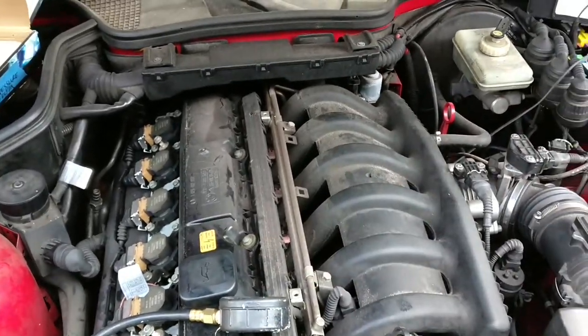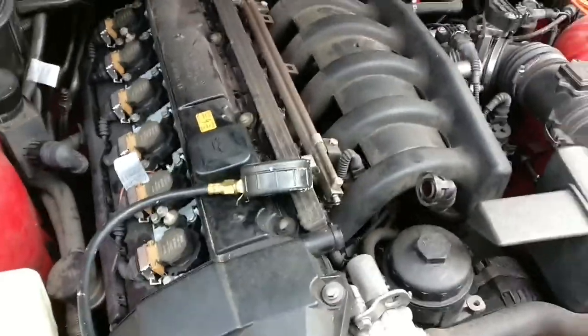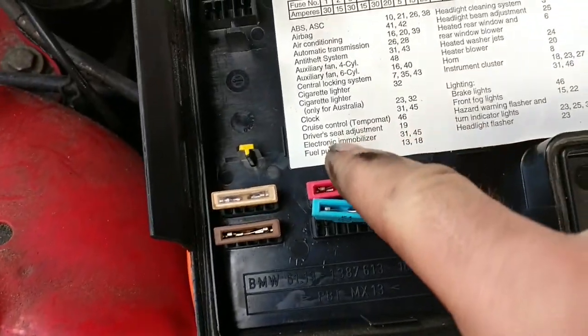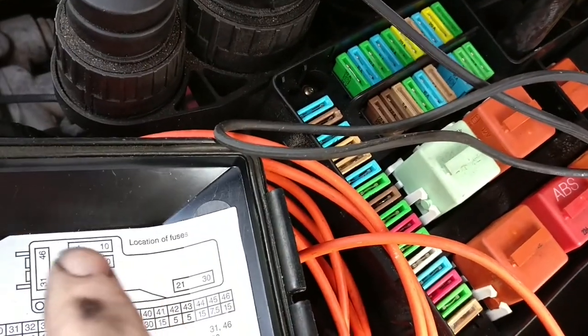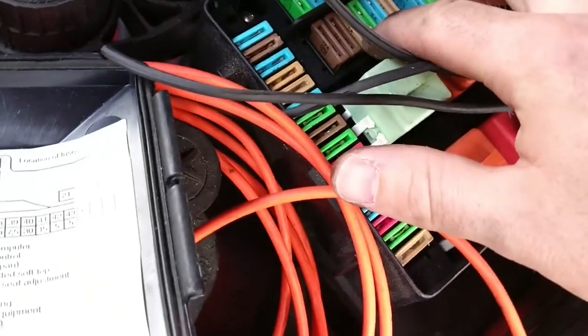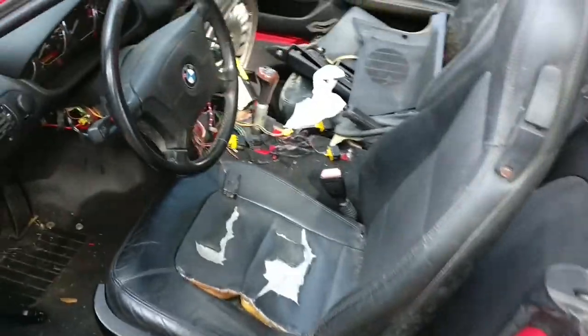And the electronics that control the whole lot. We know it's probably not an issue with the fuel injectors because we're not getting that far — the fuel pump needs to put pressure into the fuel system first. We know we have fuses 1 through 10 and fuses 11 through 20, and we're looking for fuse 13 and fuse 18. Going 11, 12, 13 — looks good. 14, 15, 16, 17 is blank, 18 — that's fine as well.